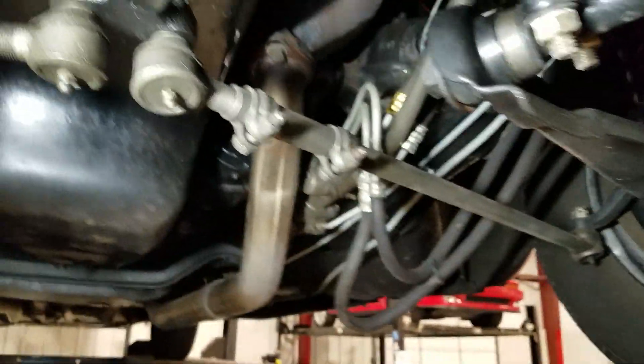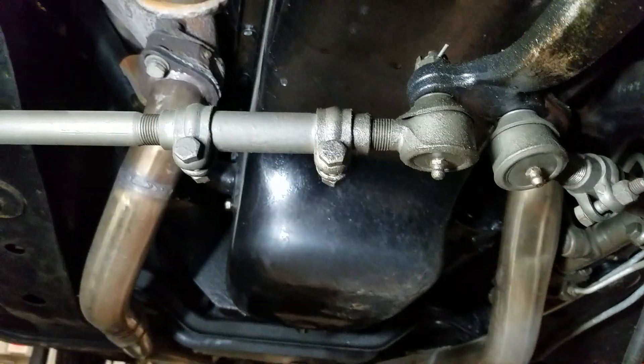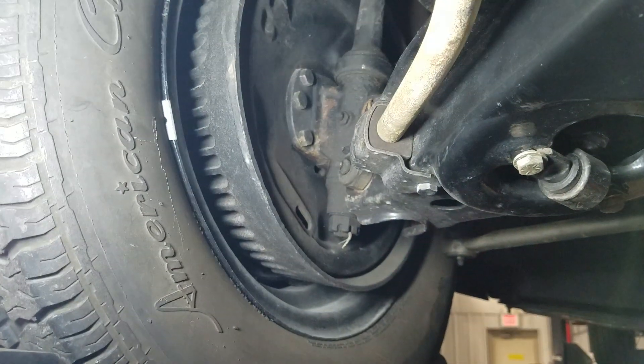I really like the detail. You can tell all the suspension and the steering assist — the power steering was pulled apart. Sway bar bushings don't have any paint on them. Shock absorber bolts don't have any overspray. Plated hardware was used in many of the locations. All the control arms and bushings were changed and serviced. All the suspension bushings and components appeared to be rebuilt and cleaned. I think some of them were painted a cast gray. Standard drum brake design in the front. These steering lines are a little bit long and they need to be tucked up so they're not dragging. But that's serviceable. Insides of the fenders, very clean.